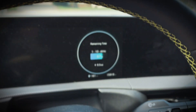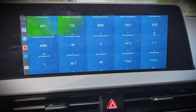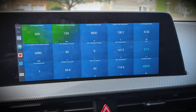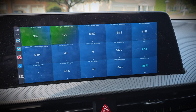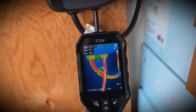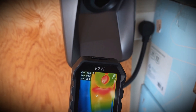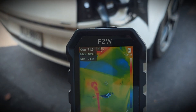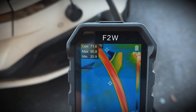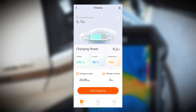All right, it's been charging for a couple hours now. Checking inside the car, we're still showing 9.3 kilowatts and everything is looking good. The charge port AC inlet temperature is only 138 degrees, so that's really good — no issues at all here. Checking the external temperatures, it looks to be in the 90-degree range, which is good — it's barely warm, not even close to overheating. And checking out the app, it shows we're still over 9 kilowatts, and everything is holding steady, showing only 100 degrees inside the unit itself.